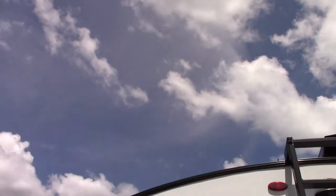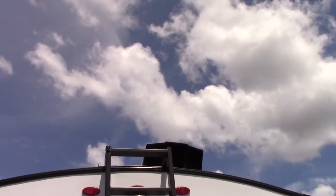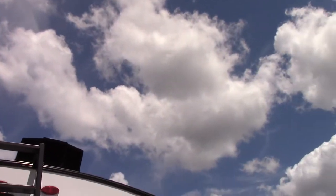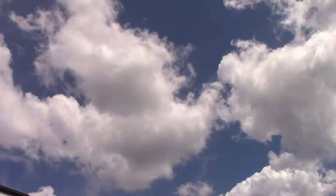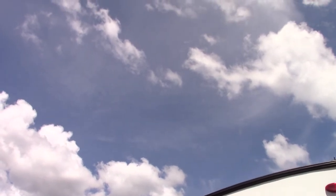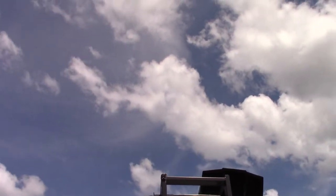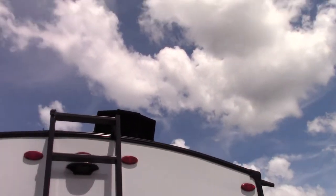You've got a ladder to inspect your roof, which is important — you need to inspect your roof at least three times a season: in the spring, in the fall, and once in the middle of summer. Walk up there carefully and look at all the sealant. If you see any cracking or separation, get it taken care of immediately. Everybody who owns a trailer has to inspect the roof — that's just part of owning it.